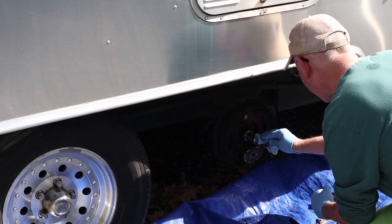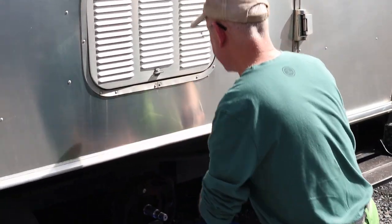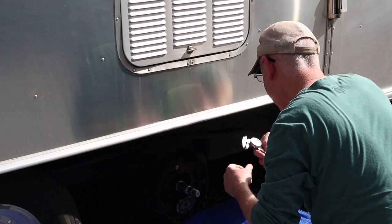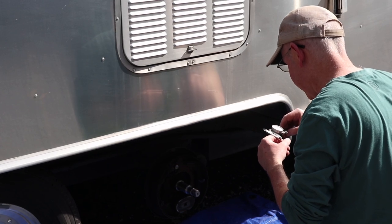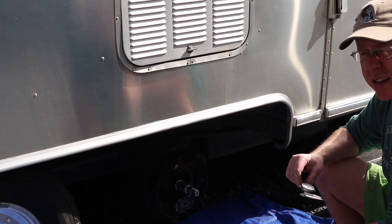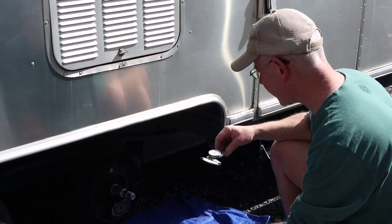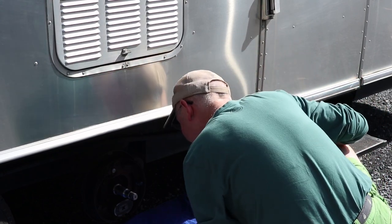We're also going to look at our brake pads. All right, we're going to use our vernier calipers to measure the thickness of the brake pad. It's not a multimeter, right? No. What's that doing? It's, yep, we're good there. So what are you measuring for? We've got about an eighth of an inch thickness, and the Airstream manual says they need to be replaced at a 16th of an inch. Oh, okay, so you're just measuring the thickness of them, right? Of the pad, yeah. Yep. And just do a quick inspection, making sure everything's looking pretty good.